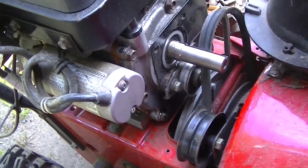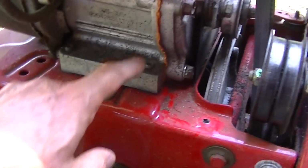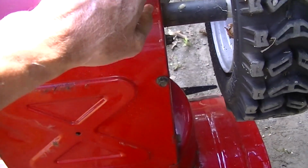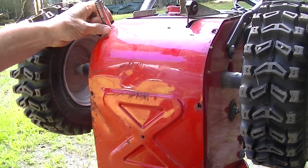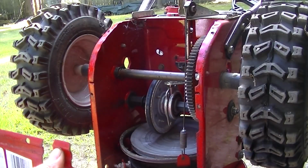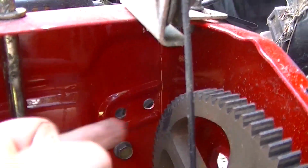So, given that it's a Craftsman too, I have to use both American and metric. And to get this engine off, it's bolted in from the bottom, so I gotta take the bottom plate off. Not too hard. So yeah, we got these 4 bolts we gotta take out. Yes, we have been in here before. We got 1, 2, 3, and 4. Still giving it the finger.